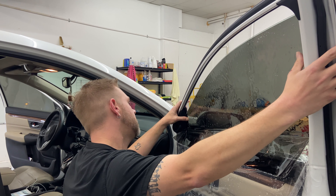Grab the bottom and lift it up. This is a two-stage — this is how I roll. I try not to take anything apart; it's just my motto. So we're gonna spray out the bottom, flushing out anything that may have trapped its way underneath. Pull slightly on the film to roll it in. Get to the middle part — put my finger here and pull slightly on the film to roll it, using my finger to keep it from pulling up the film we just squeegeed. Grab it here in the middle right where our soap line is, reach up underneath with our sprayer, try not to touch the film, and spray to the sides from the middle, flushing any contaminants.